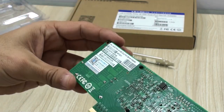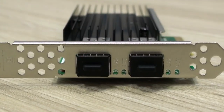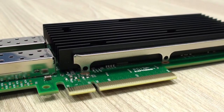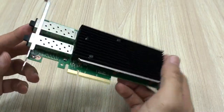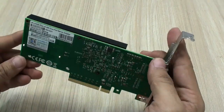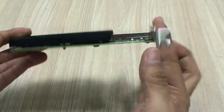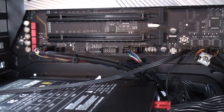The card is very well labeled so you'll be able to identify it easily in future tech upgrades of your server. As general information, this is an 8x PCI Express card, which is more than enough for the data transfer rates it is capable of handling. It is based on Intel's XXV710 chipset, similar to what we saw in the 1021 model. You can install it on PCI Express version 2, 3, 4, or 5.